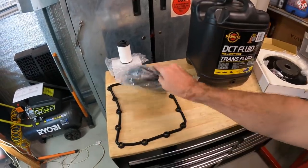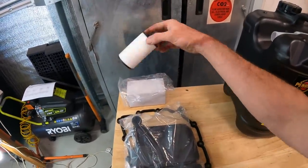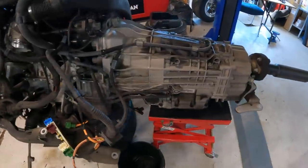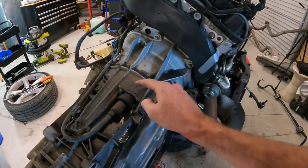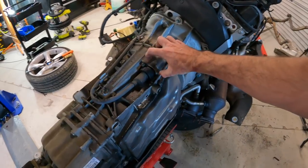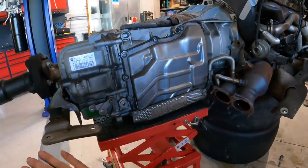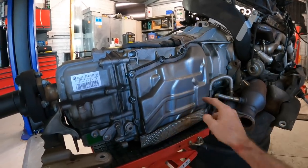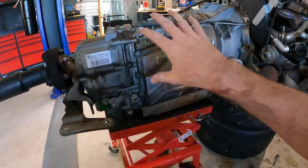I've also got an aftermarket filter — this is the main pan filter in the DCT, which sits at the bottom of the box, and that is the pan gasket. Then there's the side filter that goes into that little section there. My mate at BMW said a lot of the warranty work on these DCT transmissions was due to the O-ring failing on the Mechatronics sleeve, so I've ordered that O-ring direct from BMW for about $40. While the transmission is out — and I bet it's never been serviced — I'm going to do the gasket on the Mechatronics pan as well. Make sure you get it serviced before you throw it in.